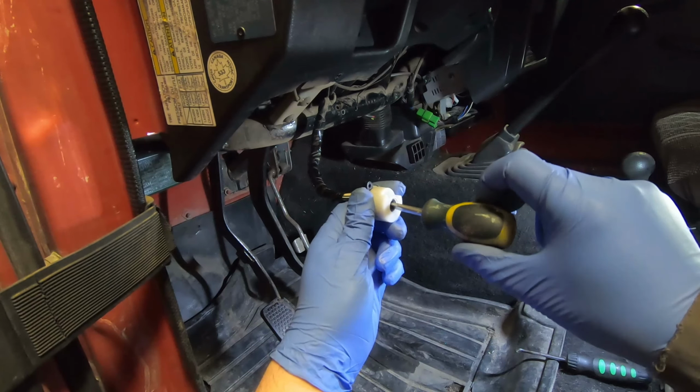Now, what actually helped it get better? Number one, definitely having the contacts clean. I think that's really important. That's the bare minimum. Having the contacts level and smooth and completely like a level surface for all the contacts, I think that's probably important. What are the other ones? So having a constant pressure spring, maybe that helped. And then having a slightly wider contact button basically for the starter circuit, maybe that helped as well. But basically, putting them all together, it seemed to work.